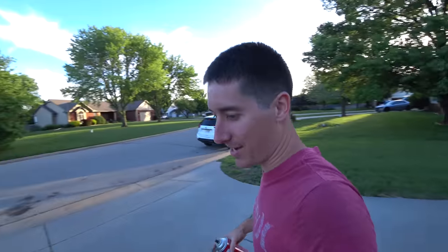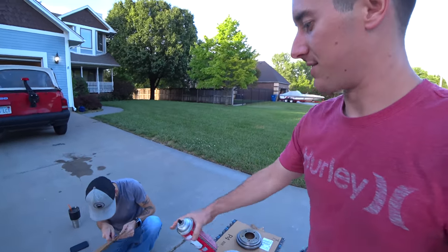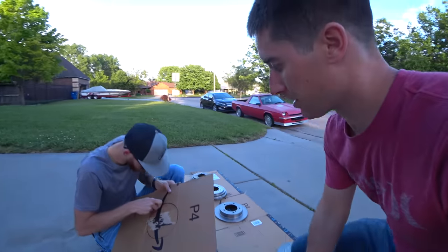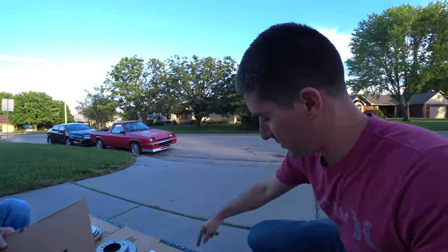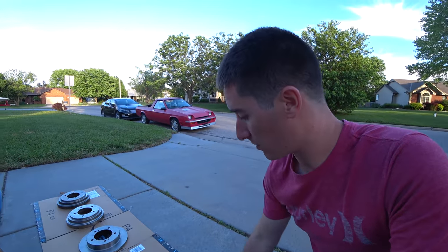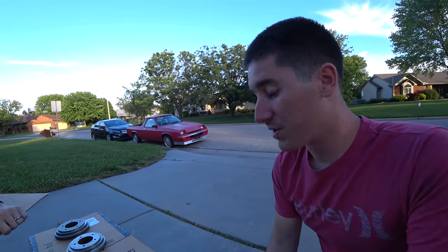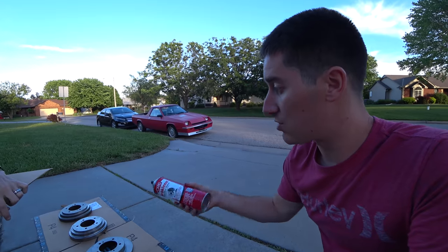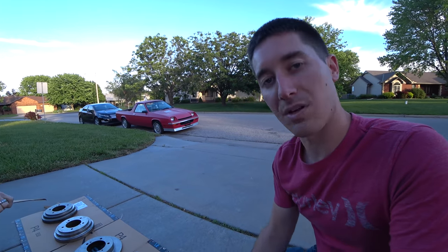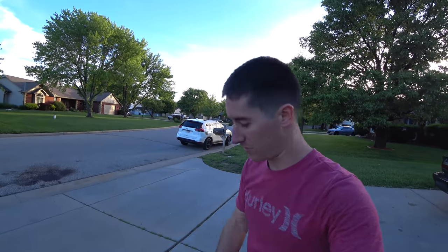Alright, we've got all of our brakes laid out here. Here are the two rear drums and here are the two front discs. Zach is cutting our template here — I wanted a little masking template so we can get paint all the way to the edge without getting it on the actual stopping surface of the rotor. That should prevent any rust in that corner. While he's doing that I'm going to take some brake clean and soak the rotors and drums to get all the packing oil off them, because we're going to paint them right here on the cardboard. Duplicolor caliper enamel with ceramic — that's what we're going to use on the drums and the rotor hats. Should look pretty good.